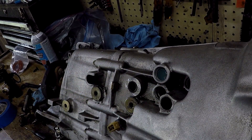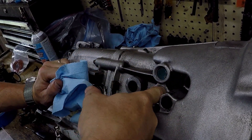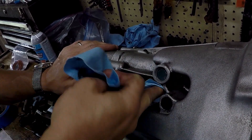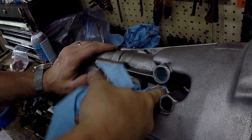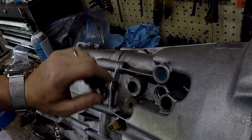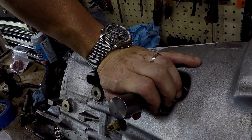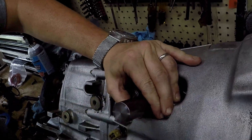Just want to check the inside of that bore to make sure it's not too boogered up — this one was okay. Get the new sleeve out of the kit. BMW makes a special setting tool; you can get them from third parties now and they've become fairly easy to find. There's the fitting tool — the shorter one goes on the fifth gear and the slightly longer one goes on the reverse, based on the depth of the casting.